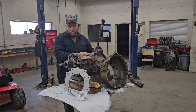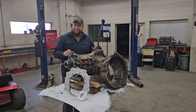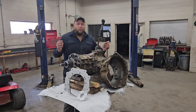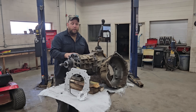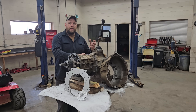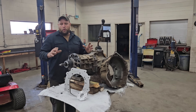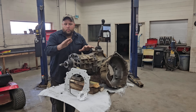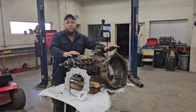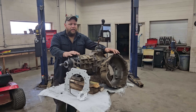I went ahead and got what I needed to do this modification. All this is made possible because of this plate here. In a nutshell, these transmissions never had a small block Chevy or an LS pattern bell housing. So with the aid of this adapter plate, we mount it to the transmission, then we can bolt on just a regular bell housing from a 4L60E or a 4L80E.